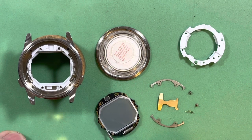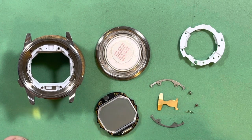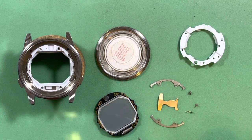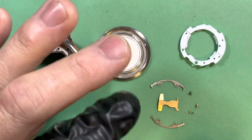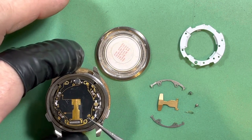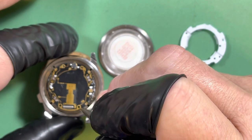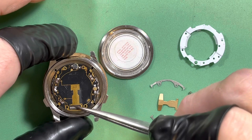That's the reflecting mirror that you see right there moving back and forth. Basically you have this free-floating LCD screen with all the elements that if you look in the light one way, you can see. That's back in place. So now I'm going to drop this section of the circuit into a movement holder — the best holder, especially for something with an absolutely irreplaceable LCD panel, is to keep the holder in the case.